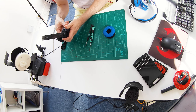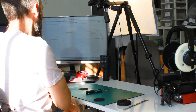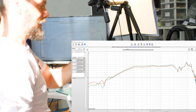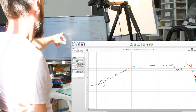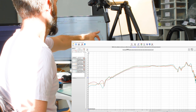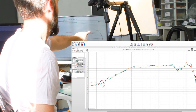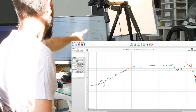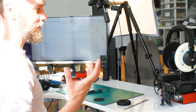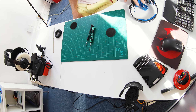One more interesting comparison — old pads versus new pads. The old squished-down pads are pretty similar along the bass, but you get some changes in the treble: an additional peak quite high around 16kHz — probably at the top of most humans' hearing range — and a little more of a peak and lump around 3kHz. So changing from old pads to new pads you'll probably notice a slight change in sound, and gradually as the new pads break down it'll go back to the sound you remember.